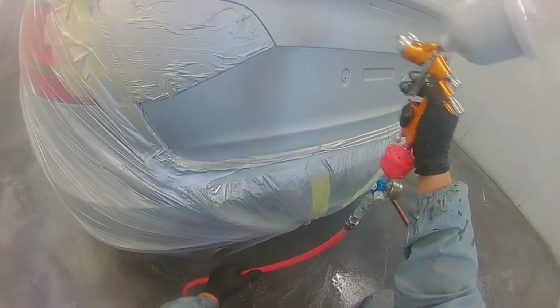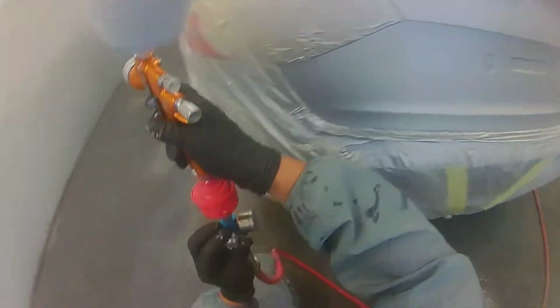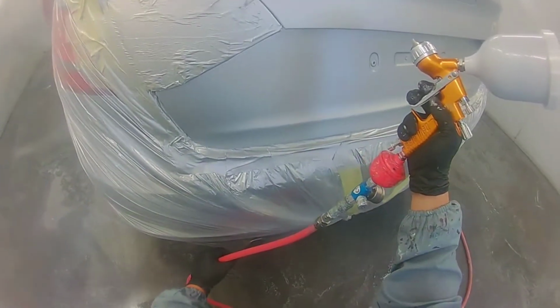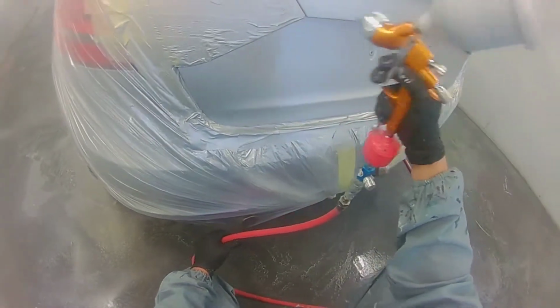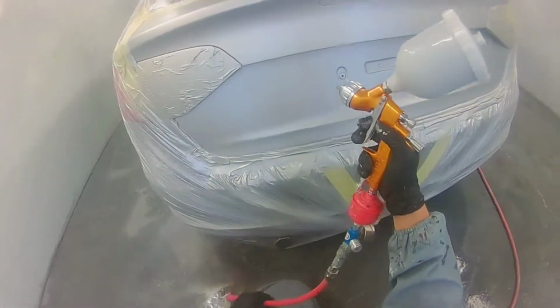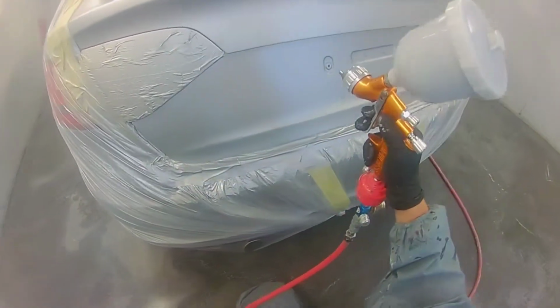So I decided to flash that off completely. I cut some of it out, just puffed a little base coat, saw how it reacted, and it worked perfectly. It seemed to just cover them up straight away. So I decided to just carry on. Put some light coats on, kept it at 2 bar, and dried it completely in between coats. And yeah, it was just working an absolute treat. It didn't take me much longer to do, which I was extremely happy about.